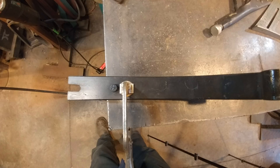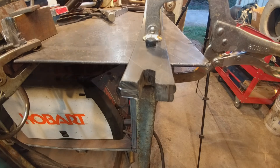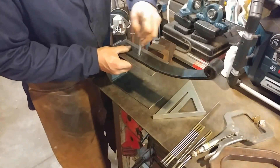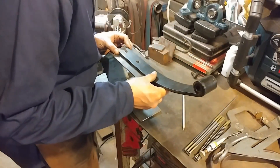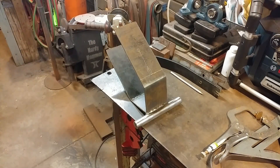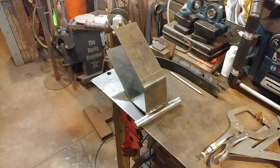Right here we're looking at this notch and you can see the bolt that's still holding the stack together — that's going to be crucial when you go to install this. We don't want to have to re-temper our spring, so we had to cut it. There's only one hole in the spring to begin with, so we need to create a notch where it slots in on a second bolt so it doesn't spin. Now we're going to mark this out on both sides in the center of the piece, and then we'll get it drilled.